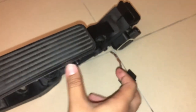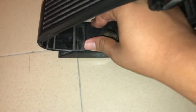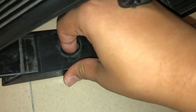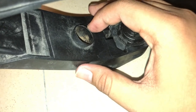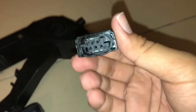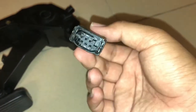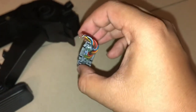Normally you would also have another screw here, and you remove that with a 10 millimeter wrench. I actually made this video because I found this throttle position sensor connector in my car — I think this was the old throttle position connector, so my car has probably been having TPS issues for a long time.